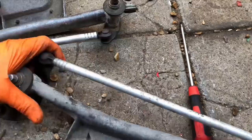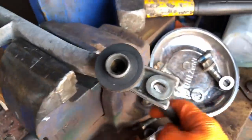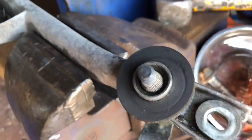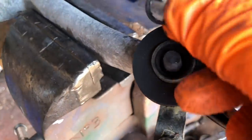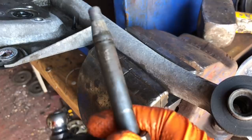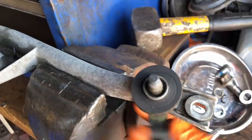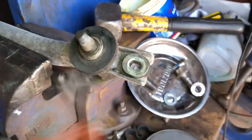I cannot move these arms at all - they've seized up inside here and that's why you've got to keep them properly lubricated. No one ever does and they seize up like this, especially after the car's been sitting for a long time. With my other one it's already greased up and you can actually move the arms backwards and forwards. So luckily it's just the arms and the motor is good. I'm going to disassemble the wiper mechanism - this is the arm that attaches to the wipers. On the top you have a washer and a split pin, and there's a little O-ring washer. Once you take it all apart you can brake cleaner it and you can see why they seize - because of rust and when the grease dries out they just get stuck. I'll clean all that out, lube it all up with fresh grease.